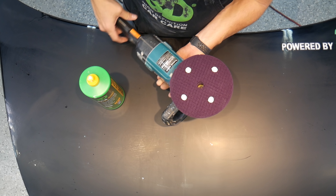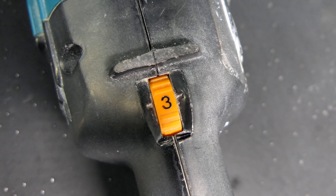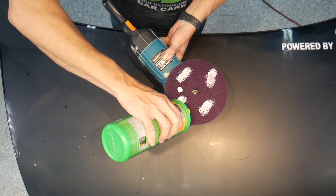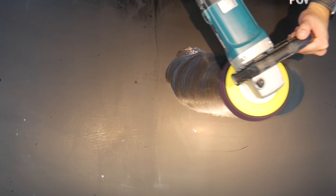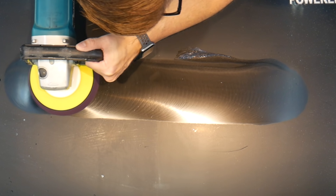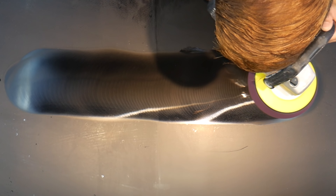We're using the 3D ACA 500 on a foam pad. Since foam doesn't cut quite as fast as wool, we set the speed at level 3. We want to show you that the product itself is going to provide an easier buff cycle when you're using the right sandpaper, and that's how important it is. It's not just a process of removing debris and leveling surface — you also have to look at the end results: how well does it polish. We're going in nice, even back-and-forth motions, keeping it nice and flat, trying to get the same amount of polishing steps on both sides.